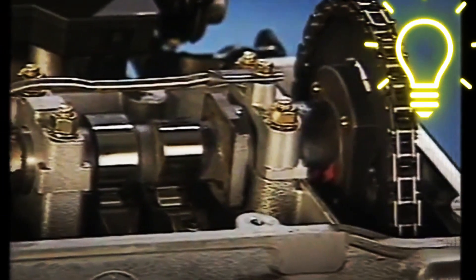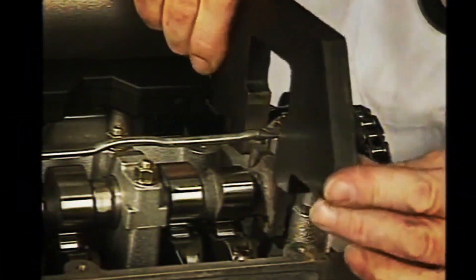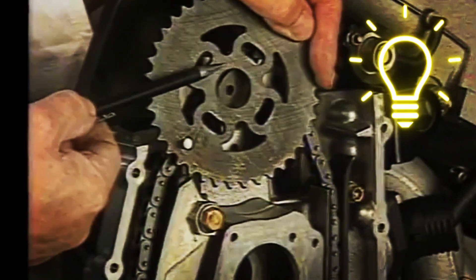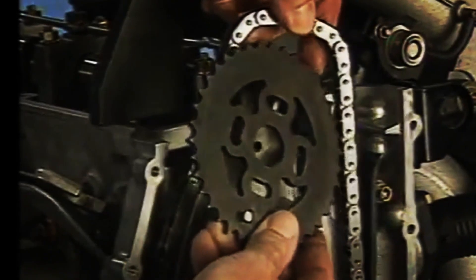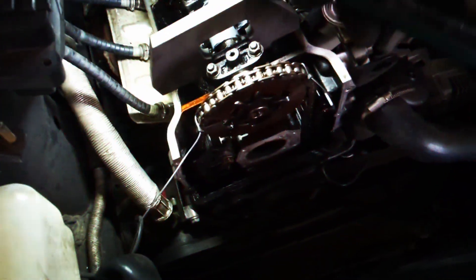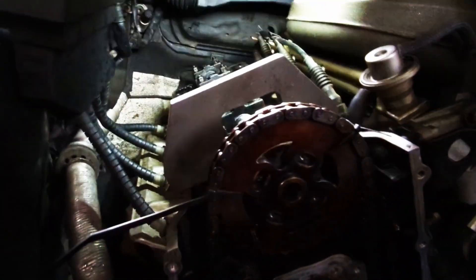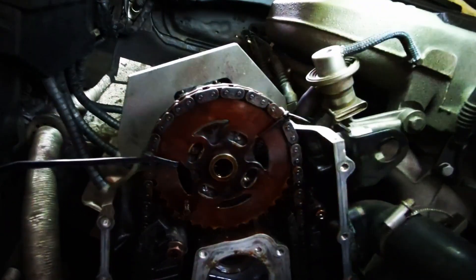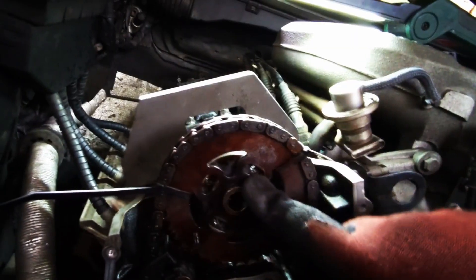Next, pay attention to how to set the proper camshaft timing. With the camshaft lobes in the correct position, put the special cam locking tool into position. When installing the chain sprocket, pay attention to the arrow mark — it needs to point up due to the camshaft positioning sensor. I put the timing block back on just to make sure it's still flat, which it is, and put the cam gear back on in the same position as before.